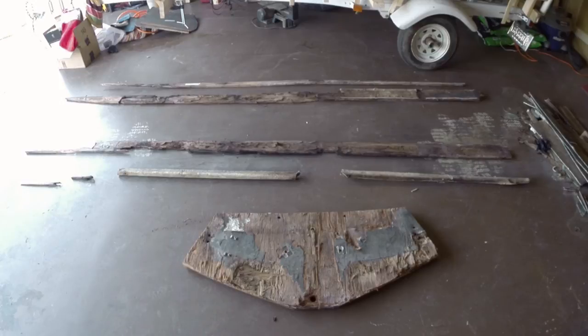So stringers and transom removed. I've also already bought some flap discs and I bought a suit with a hood. As you saw in this video, I was wearing my respirator. Next — foreshadowing with all those inputs right there — is removing the excess fiberglass leftover from where I cut loose the stringers. I'm going to use the flap disc to grind the hull so I can get down to the fresh fiberglass, being ever so careful not to grind through.